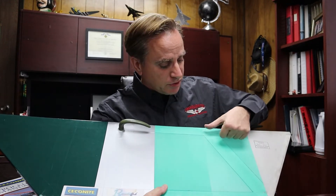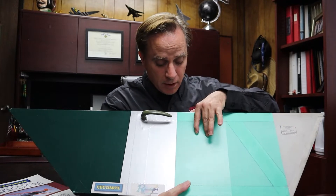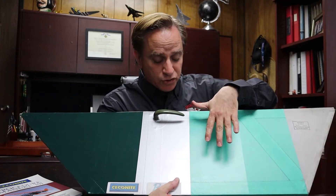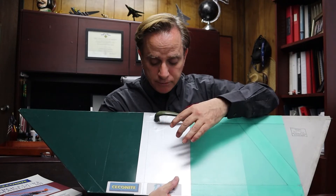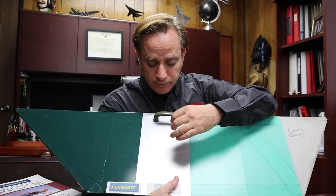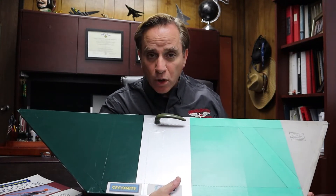You lay the tape in, wring out the brush, and go over the top to make sure it's smooth. Two coats of nitrate butyrate are sprayed on, then the transition comes. Three coats of butyrate dope are now put on. Scuff or sand with 400 wet paper. Two coats of silver butyrate dope for UV blocking are put on, sand with 400 wet paper, and then two more coats of silver butyrate dope are put on. Allow a few days to dry, even putting the components in the sun.